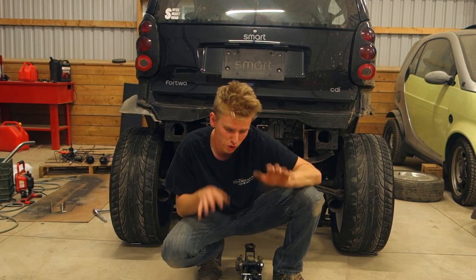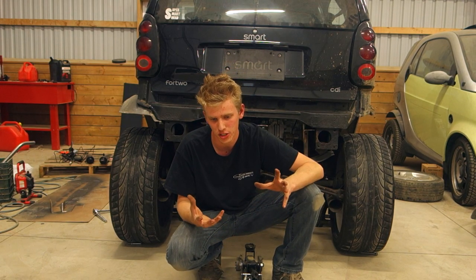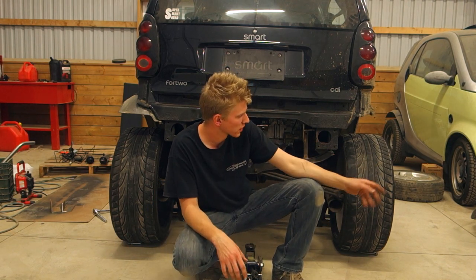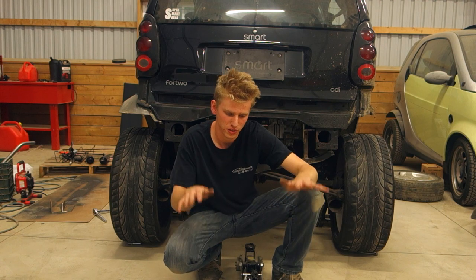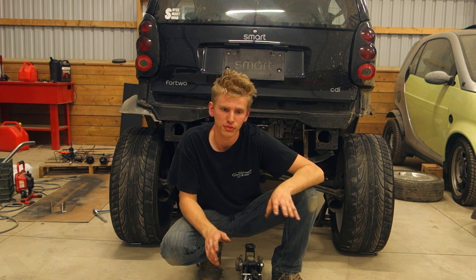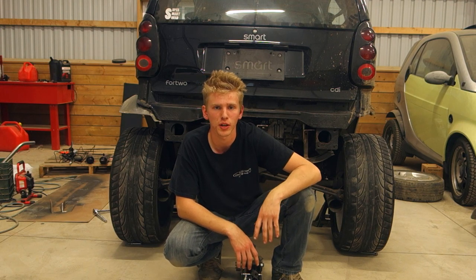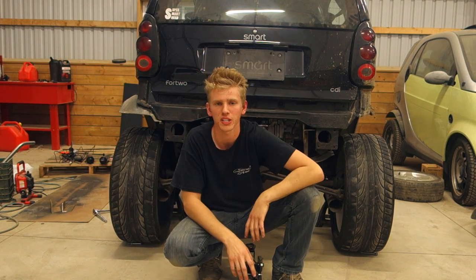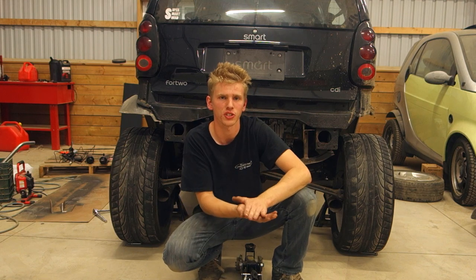We want our ride height to be all the way up on the shocks. To mock that up, we've got both tires in here and we're going to let the car down until it's nearly centered with the tires. We'll use that as our ride height reference using the fenders. The reason for having the air shocks all the way up at ride height is so that if we're driving and we don't want the suspension to crush the fenders, we just pump them up to 100 psi — enough to keep a little bounce but not so it comes smashing down and wrecks the fenders. At the same time, at a show we want to be able to lower it down so the fenders are just not touching the tires.